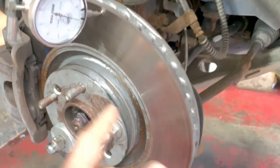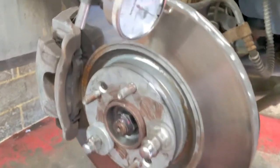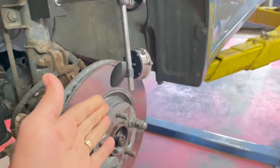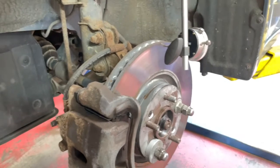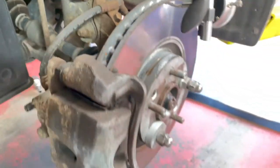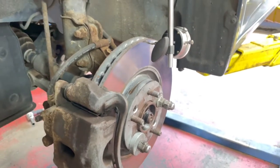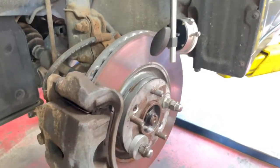In this situation we have to replace the disc again, but also the hub with the bearing. When there's a vibration on braking it's not necessarily just down to the discs — the plate behind them could also be affected. Because the disc is so new, it's very unlikely to be only the disc; more likely the disc has been affected due to the underlying hub problem.